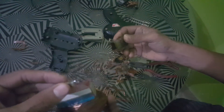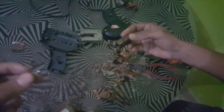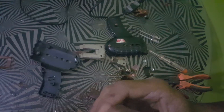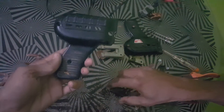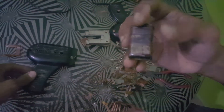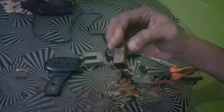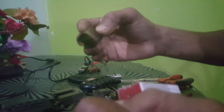I opened the primary winding and found it burned inside — it's totally burned. This is a soldering gun, and it was working but with a burning smell. So I am removing the coil.